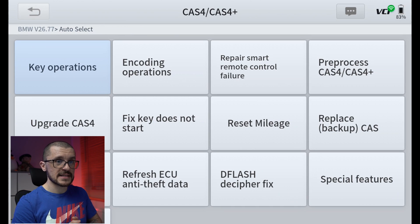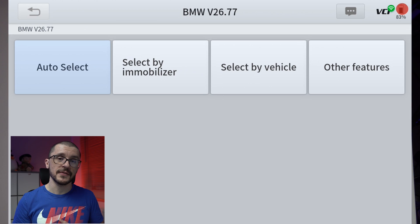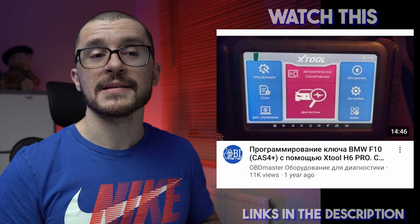This is the more extensive menu — a menu that you will not find on the D7 — and should you test it on your vehicle, it might work. Looking at other videos and people using X-Tools to perform these tasks, many of them say that when doing the pre-processing, you will want a wired connection and should avoid Bluetooth. The D7W uses a wireless connection, so you might be safe based on that.